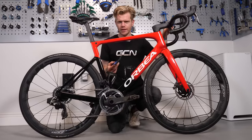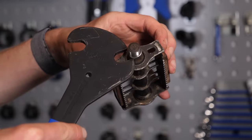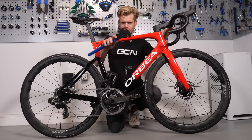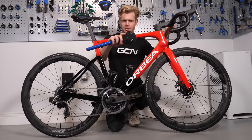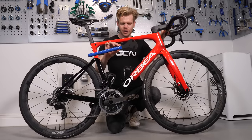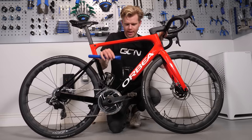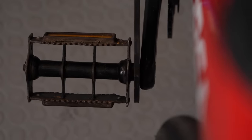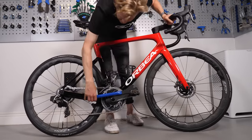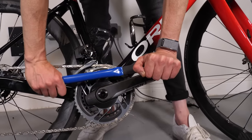Alternatively, if your pedals aren't designed to be undone with an Allen wrench, then you can use a pedal spanner, usually on the gap just on the outside of the pedal before the spindle begins. A dedicated pedal spanner is a great tool because it has two notches in different orientations, so you can get it in the optimum position to exert maximum leverage. With the crank in the forward position, apply the pedal spanner so it faces backwards along the length of the crank, then push down — you can put force through the pedal with your hand or your foot — and it's undone.